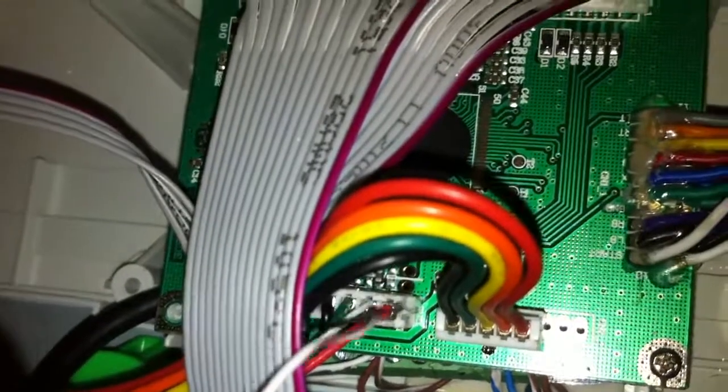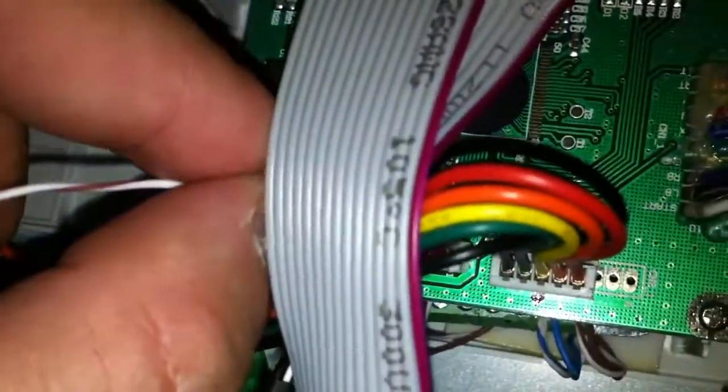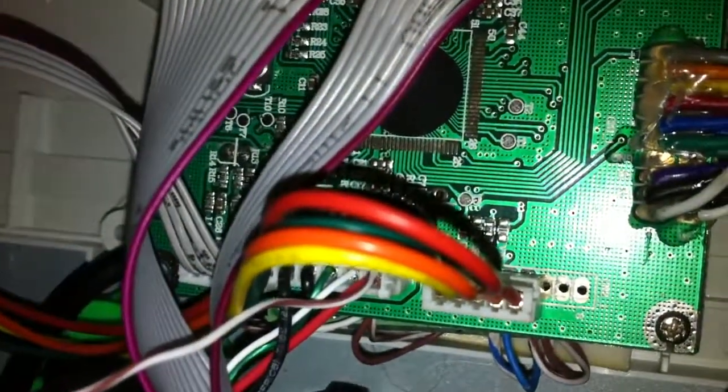This will go here — these wires should reach your buttons easily. And then, as I said before, this one you're just gonna shove down into your USB cable. This red cable right here — red, white, green — that's your USB cable. So you're gonna take your solid wire here, and you can unplug this little harness just to make it easier. Yeah, just take this wire and shove it in there — there are little gaps on the side. Then shove it in there and put some hot glue on it. Call it a day.